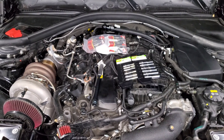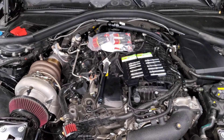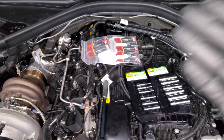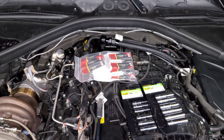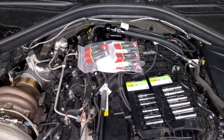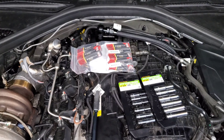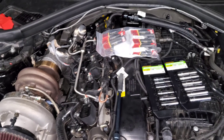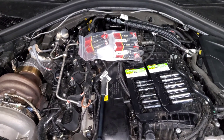We're back looking at the engine bay and in this video we're going to be replacing the spark plugs on my 440i. I went with Champion plugs — my car came with Champion plugs so I'm keeping them and leaving them at the stock gap. You really shouldn't have any issues with stock plugs at the stock gap; you don't need anything colder and you don't need a tighter gap. There are plenty of people making even more horsepower than me running stock plugs — I'm around 600 horsepower but there are people making over 700 with stock plugs.